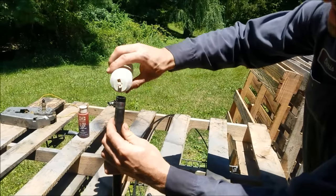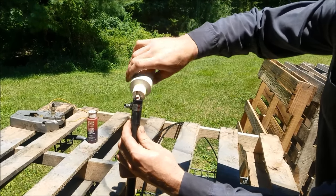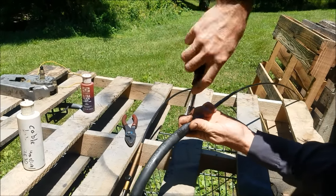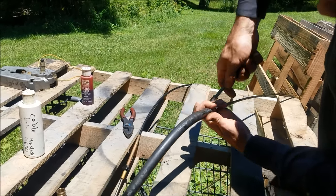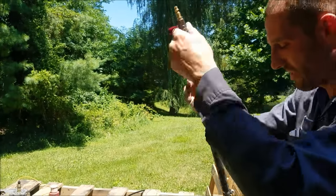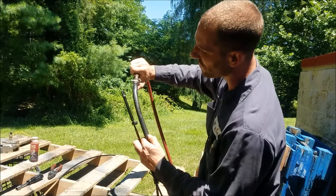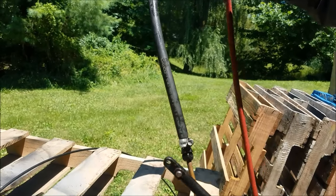The process is pretty simple. Take your cable lube and fill the hose up with more than you need. Pull the cable out, slip the hose over it. If you're doing motorcycle cables or other types, you'll need a different size hose. Flip it upside down and let it sit for a second so the lubricant hangs in there. Then take your compressed air and hook it up. Put your safety glasses on — very important. Make sure whatever hose you're using is rated for high pressure; this hose is rated for 200 psi. Otherwise it could blow up in your face and shoot oil everywhere.